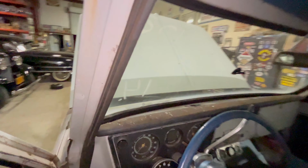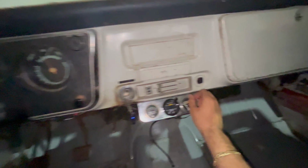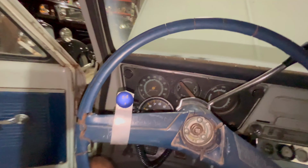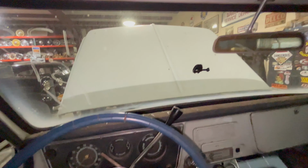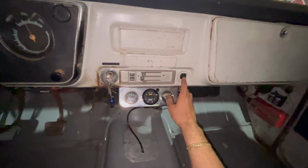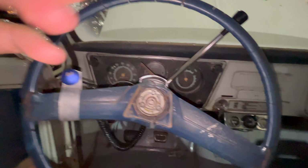Now, in here, you're gonna have your arm switch, which will be wired up through the nitrous. What that's gonna do is that if you hit the nitrous button here to activate it, if that switch is not flipped on, it will not work. So you don't wanna be accidentally driving down the highway, hit the button, and kaboom, you blow your motor to smithereens. You don't want that. Not that it would if you got it tuned up right, but if you have this button flipped on, that activates your button or your foot pedal, however you want to wire it up. So that's an important thing.